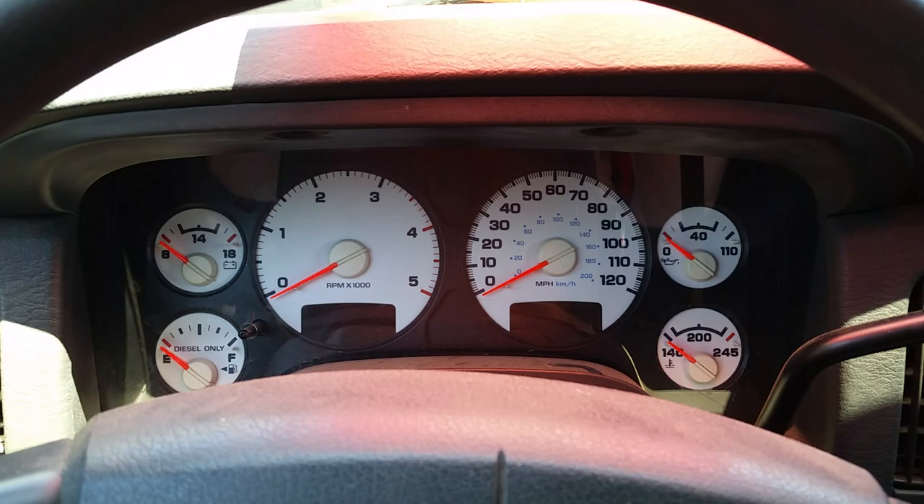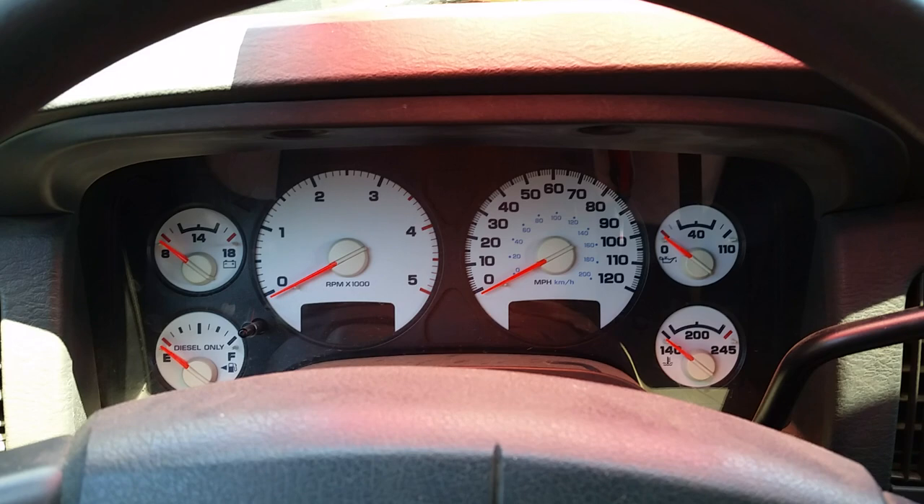So there's a key on and off procedure you can use to activate or deactivate the safety feature of your truck. You start with the key in the off position, seat belt on. Turn the key on and wait for the seat belt warning light to go out.